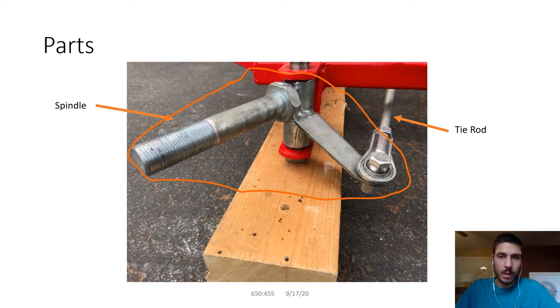This is a fairly basic design that many go-karts use. There's also another design — the rack and pinion setup — where you have a rack and a pinion gear and a steering column which usually has two u-joints so you can adjust the output shaft with the pinion gear so that it's horizontal with the ground. But this design is based off of just a spindle, tie rod, and pitman arm setup.